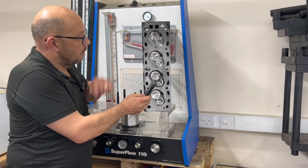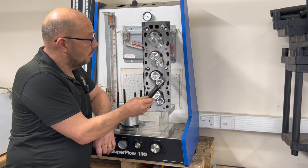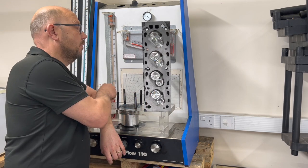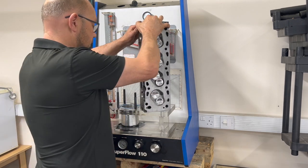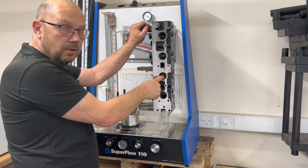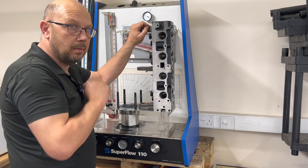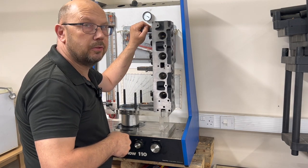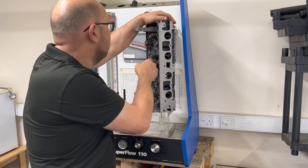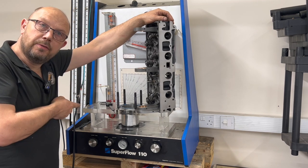So what have we got? Well we've got some 45.5mm inlet valves and 38mm exhausts. It's nicely finished, faced on all sides, it's very clean. This is not an injection casting — with the right port in it doesn't make a great deal of difference. It comes with all used springs, guides, heavy duty single springs, and this is the flow bench we're going to run it on.